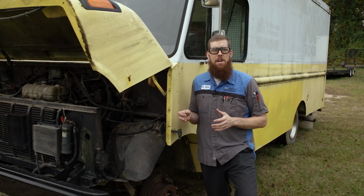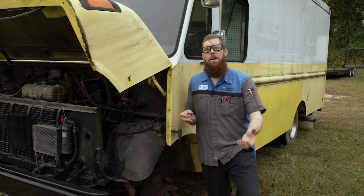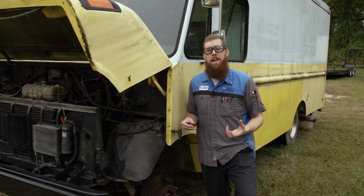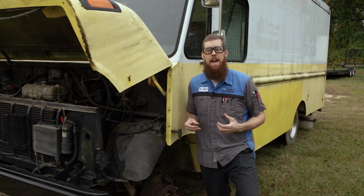And then at the end of the video, we're gonna take that brake hose loose, see if we've got fluid coming from the hard line to the hose. And if not, we're gonna track back up the braking system until we find our blockage, our issue, while we don't have any brake fluid reaching the caliper.